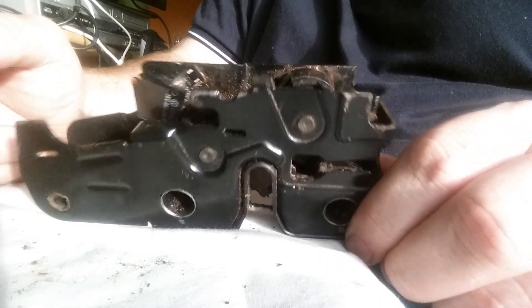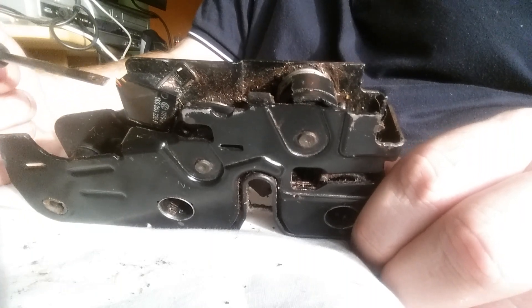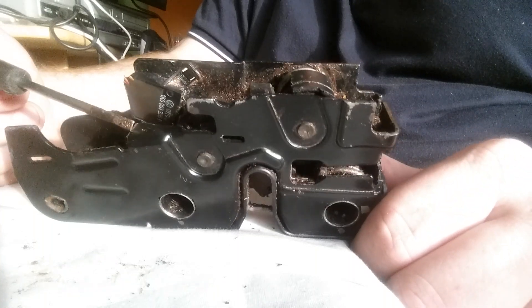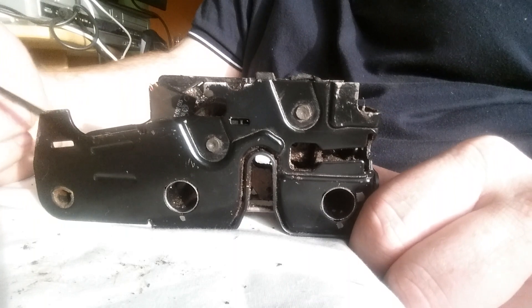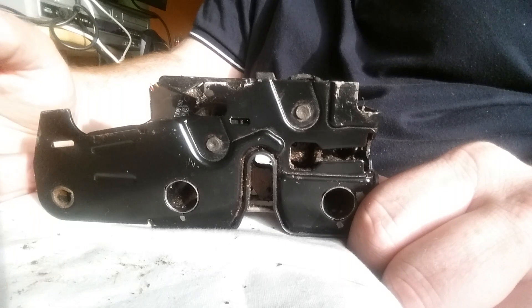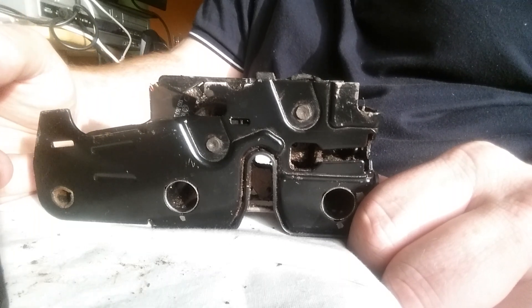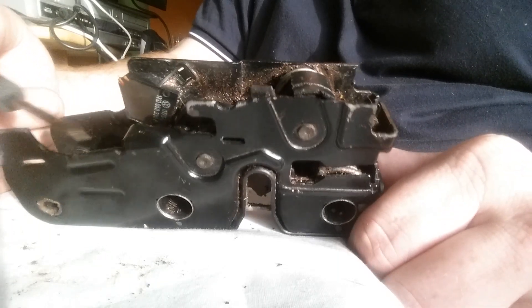The only other things you've got to do is make sure the alarm connector is clipped in and firmly in its slot, which is roughly behind the radiator and near the headlight — there's a little housing for it. Now obviously if the bonnet isn't all the way down, the windscreen wipers won't work on your car. So if your windscreen wipers stop working or the alarm doesn't activate, that's probably a problem with the bonnet lock. That's something to take note of for future use.